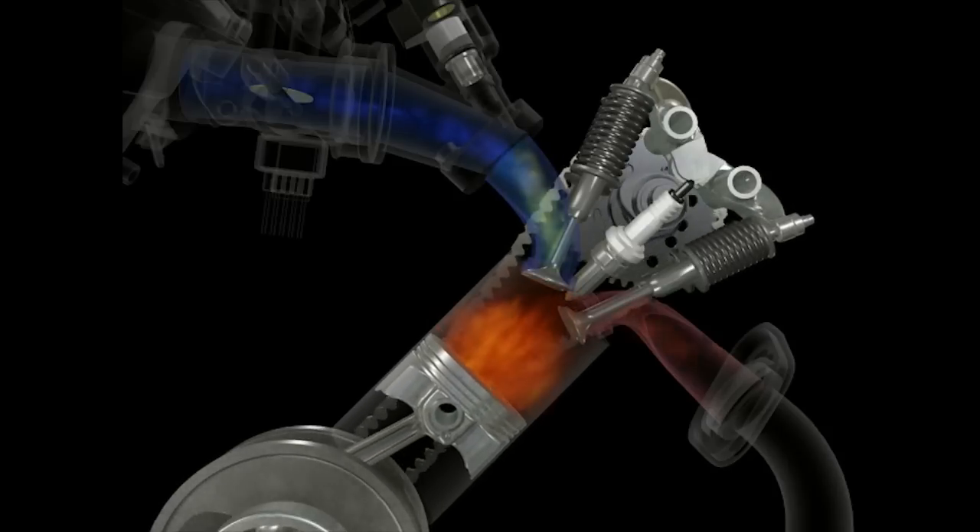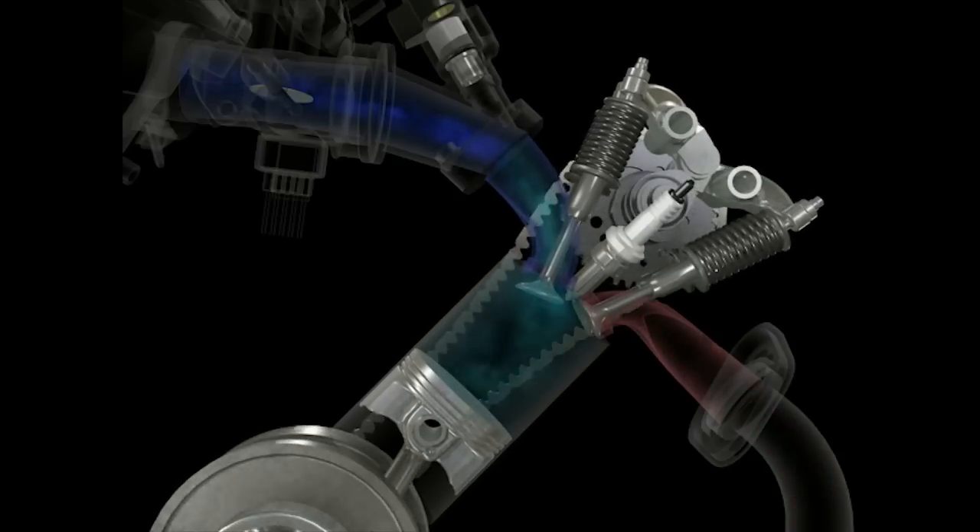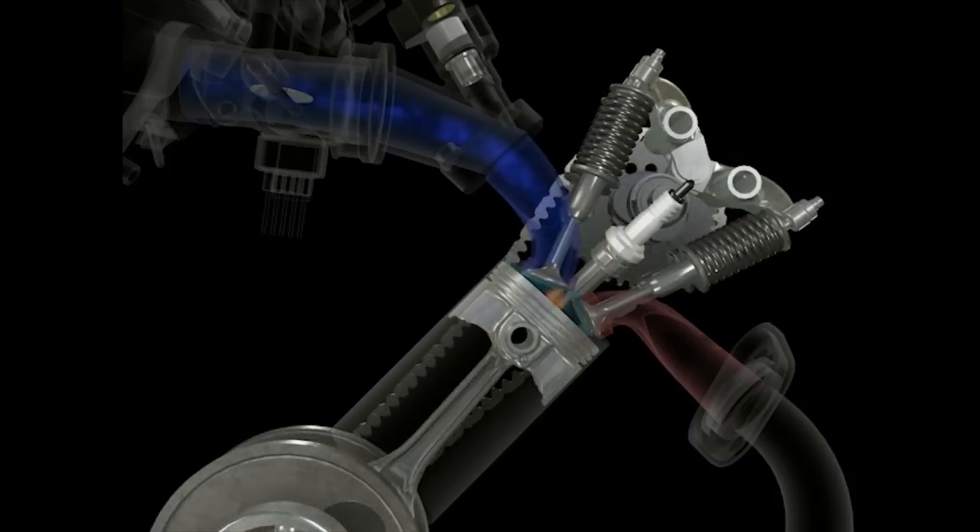If you hear five good clicks every test cycle, it's safe to assume the fuel injector and circuit are electrically okay. But unless we're looking down the intake track, we really don't know if gasoline was actually spraying into the engine. We'll talk about a very easy method to determine that without having to remove the injector or air box and maybe a bunch of fairing panels in the next section.